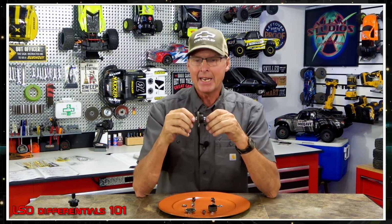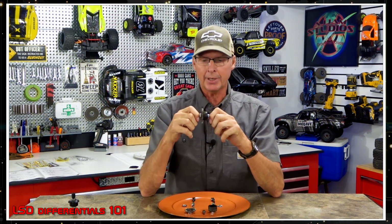Once you put that fluid in there, that fluid keeps the same basic resistance throughout the arc of power. And what I mean by that is, even at slow speed, you feel this resistance. I can feel it right now and I'm barely turning it, okay? So with a stiffer fluid in here, you get that all the time. So now if you have a really stiff fluid in here, let's say you put 1 million in here because you want to do backflips, okay, that's cool. Whatever works for you, I'm down for that. It's fun to watch, it's fun to do.